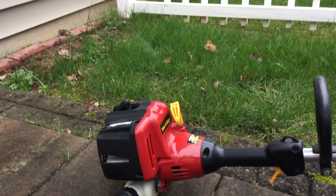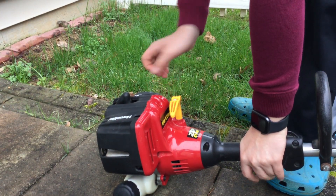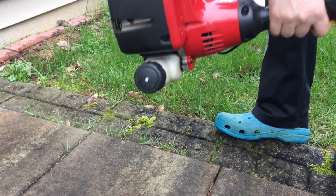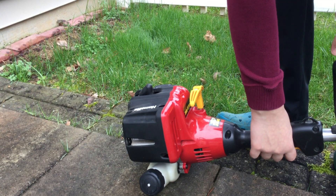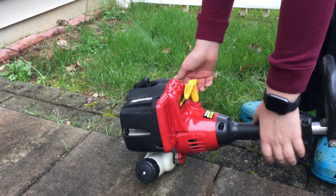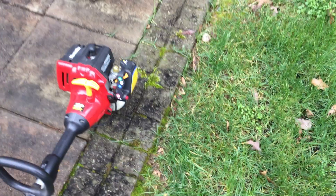So let me start it up right here. Homelite trim and edge - let me squeeze the throttle. It fired. So yeah, I fixed the problem where it would only run in half choke. Just had to adjust the carburetor. I thought I was about to change it, but then I realized, let's play with that carb today. It was a pain in the ass to get out, but once it did, it worked. It seems to work pretty nice, so this is fixed officially. Now nothing's wrong with it.